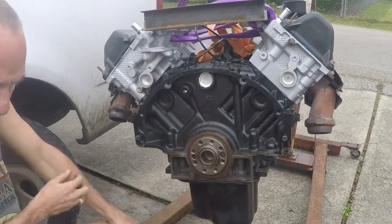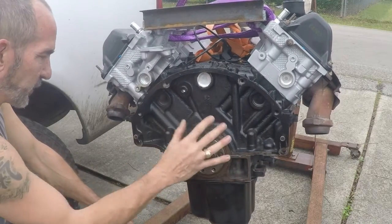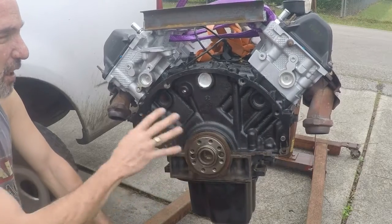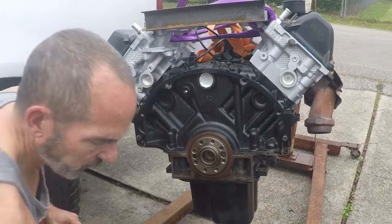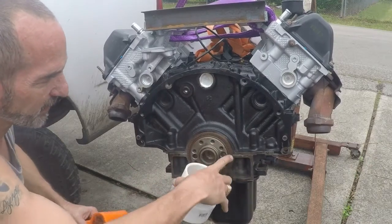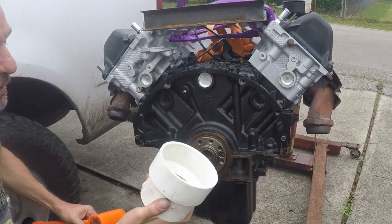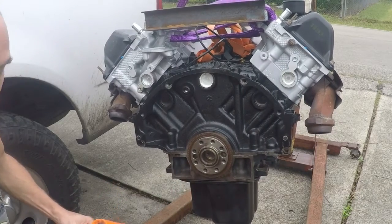As you can see, we just put the rear seal up. We're going to put the rear seal in, we're going to put the dust cover on, put the flex plate on, torque the flex plate bolts. As far as putting this seal in, it's obviously significant in diameter. I use a pipe adapter that I got at a local hardware store, same as on the 4.7.